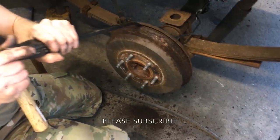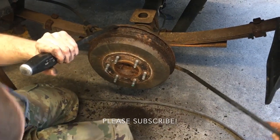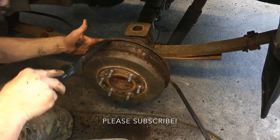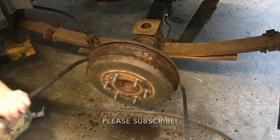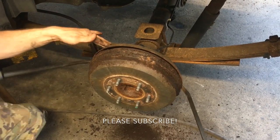Usually the easiest way, you can try adjusting the pads in the back by removing that little cover and getting a flathead in there. A lot of times when the brake pads are in really rough shape, it doesn't do the trick. So you just got to pry a little bit at a time, evenly from both sides is the best way.